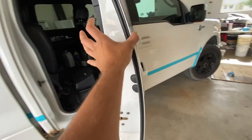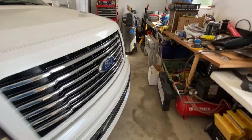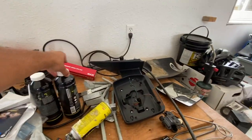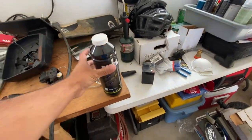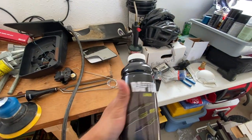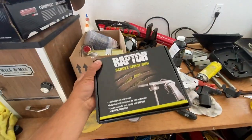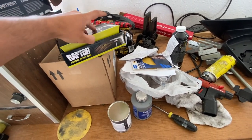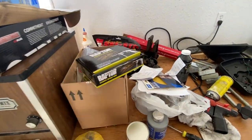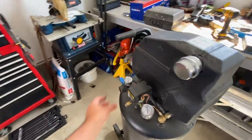With mixing up the paint, the paint I'm using is Raptor bed liner. It comes in white and black — this is the white one. It's great stuff; I've actually used it quite a bit. You have to buy a gun separately. They do have a special gun you can buy that has a regulator on it for controlling thickness, or you can just use an air compressor that you can regulate and see your PSI. That's what I'm doing — went with the cheaper gun.